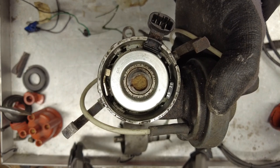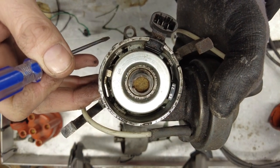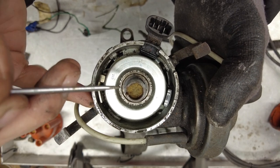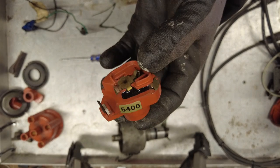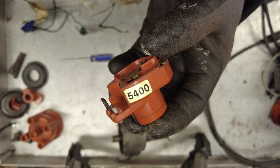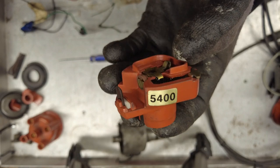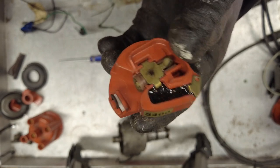You don't need it if it's a very early vacuum-advance-only distributor, but those are few and far between these days. Basically when you do your engine service every 6,000 miles or 12,000 miles, you want to be adding two or three drops of engine oil to this little pad just to keep things lubricated. If anybody's wondering why I had this rev-limiting rotor fitted on one of my 009s — it's from an original T25 engine, it mechanically restricts the revs to 5,400 rpm. If your engine is capable of spinning past that but you don't want to do it on the street, it's a handy way of stopping yourself from blowing your engine up.